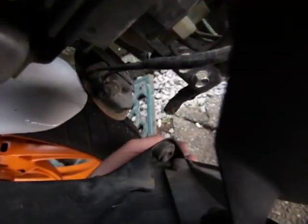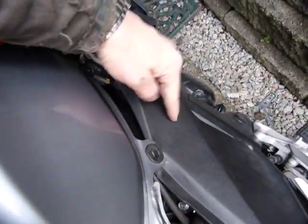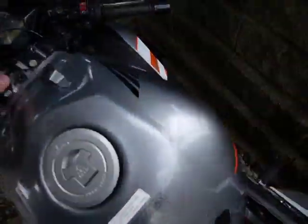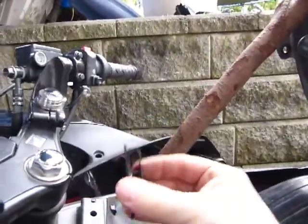Come on around to the other side. From this bracket, you need to remove that bolt so the fairing can flex out. You cannot possibly lift the gas tank without removing all of these body panels, because the gas tank goes through a side panel, or the side panel attaches to the gas tank. You can't lift the gas tank without removing all of these bolts. Then you need a handy dandy wooden stick — this is a 2011 model, just like the bike. What fell on the ground was this part of the gas tank mounting, so that goes there. Don't lose it.